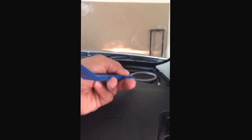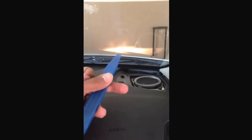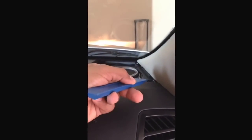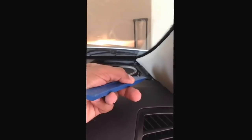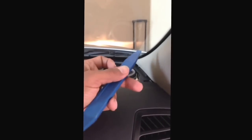There's two there and one in the right back corner. Basically all you do — I used these little dash kit plier tools and you just basically wedge it in. I started off right in the center and slide it over to the left, got those two clips on that side and just pried up and they pop right up. The one on this back corner is actually kind of hard, so don't be scared to break it — it's not going to break, just pull up as hard as you can and it will actually pop up.